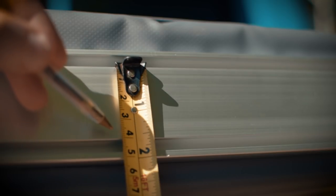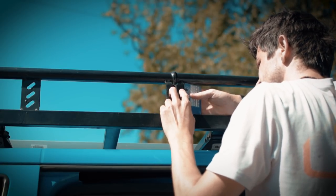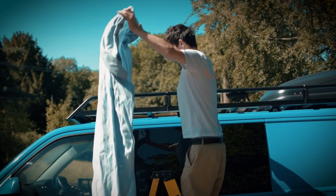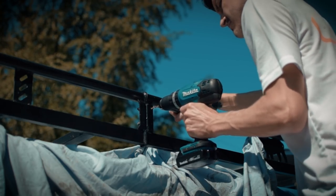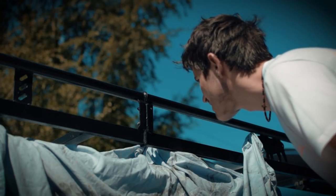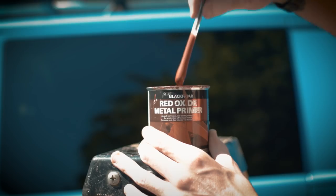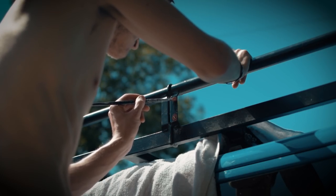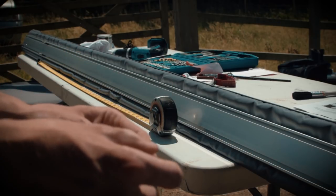To make the job simple, we made a template of the channels. This made it easier when drilling our holes as we knew exactly where to position them. Important point: make sure you cover up your vehicle and paintwork, as metal shavings from drilling can cause rust spots if left. To help prevent the roof rack from rusting in the future, we used a little bit of red oxide metal primer. We then measured the distance between the two sets of bolt holes and slid the bolts roughly into position. It's a very clever and simple design that gave us a lot of flexibility as to where we could place the awning.